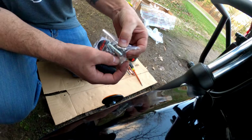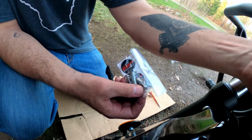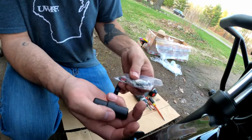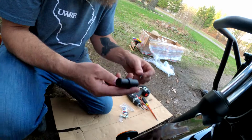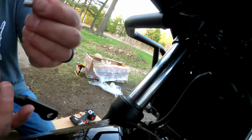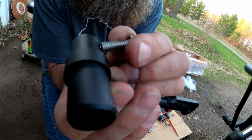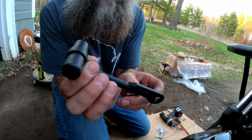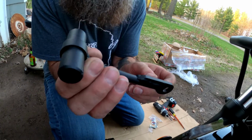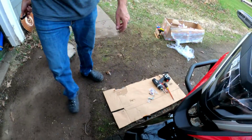See, you got these two set screws. They're pretty heavy. And those go in. There's a nut welded on the back of this. Okay. And they go into there. And so this goes into that nut in the back and it tightens against this. So it's going to hold it wherever we put it. Okay. So if we want to leave this on for now. I'd rather cut it off. Take it off? Yeah, just in case something happens, it doesn't go through the radiator. Yeah, that's probably a good idea, too.